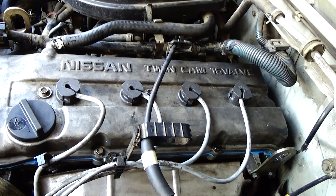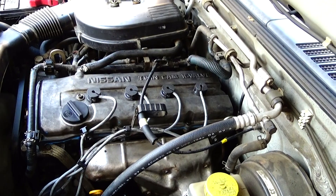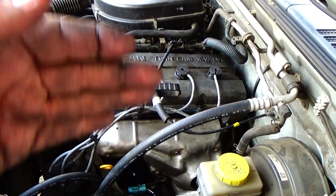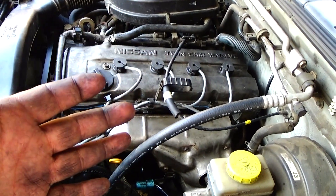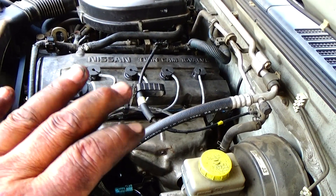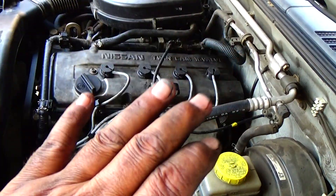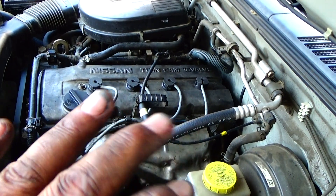So that's just a warning. If you've never done it before but you have worked on your own vehicle, I suggest you give it a try, because there's really nothing to it. Just make sure no dirt gets inside the valves. When you have the cover off, make sure it's perfectly clean — make sure you don't drop anything in there. If you drop a little screw, you're in trouble. Excuse my language. Be very, very careful when it's opened up. Do not leave any tools or screws near the open valve assembly.